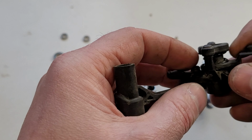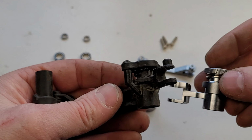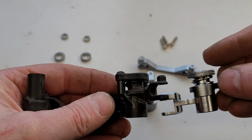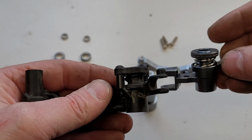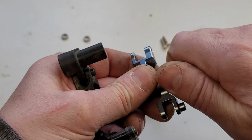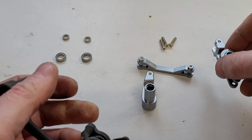So we've obviously got the spring assembly in here. Now, the springs look like there's more coils on that one, so we'll see if there's a difference in tension. But you can adjust the tension on this one by just winding down that. So we'll make that perhaps a fraction tighter when we've actually put it in the car.